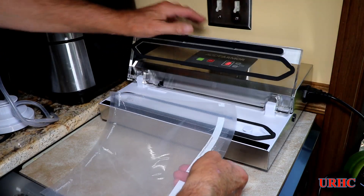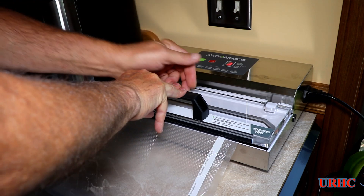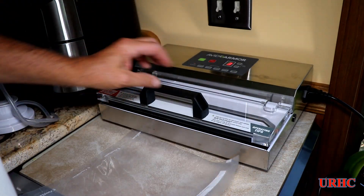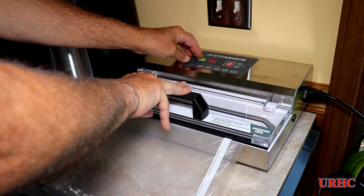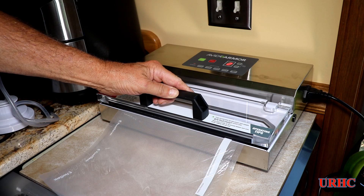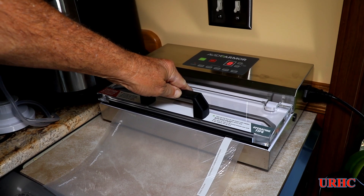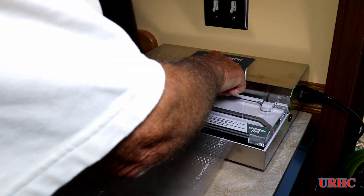I could not get the impulse seal for making bags to work. I tried approximately 25 to 30 times — I had to adjust the seal time and just couldn't get it to pull the seal down. I could push down as hard as I could, but that rubber strip over the heating element would not touch the bag to make it contact the heat strip. As long as the bag had leakage through it — and these bags have a corrugated back — it was impossible to get a seal. I did contact Avid Armor about the problem and they said you have to push harder because new seals are tough, but I wound up putting all my weight on it and still none of the seals came out right.